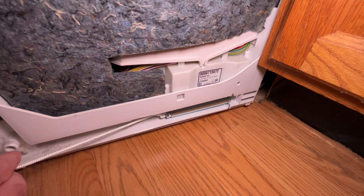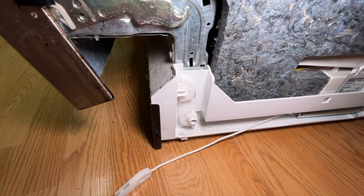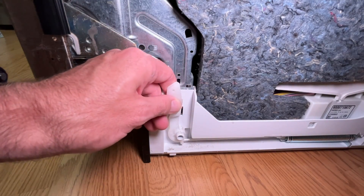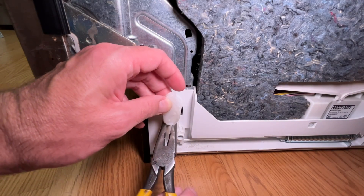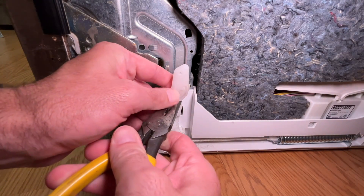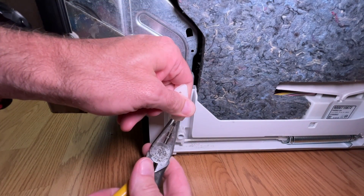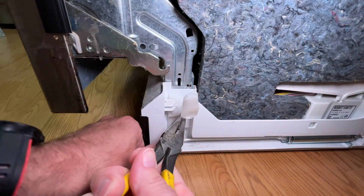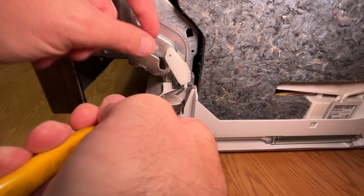Now this is going to snake through here, over here, and onto this hook — I need to reposition my camera for that. I do need to close the door. It comes through here and you can see it does not reach, so I'll need to pull on it. I'm going to use a pair of pliers — these have a cutter so I'll be careful. I'll stick it on here and pull up on it, pulling that spring pretty hard. I'm going to grab it just below the plastic so it will move a bit.